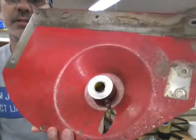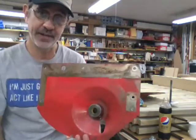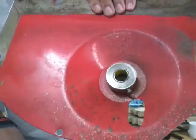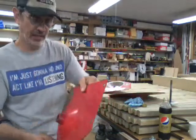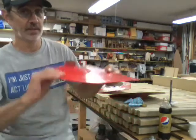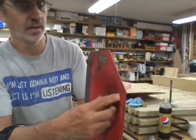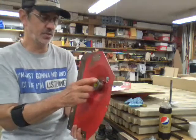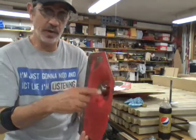There's a grease fitting on that one and it has to be pointing down towards this convenient little hole they have there. But if you look close enough, the grease fitting is pointing away from the hole — you can't get a grease gun in there, and besides, your tire is in the way. So when you put this in, I usually orient them close to that hole to give you a little more clearance for the grease gun. You're going to want to grease that, because neglecting it will wear the bushing out.